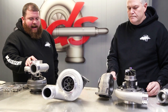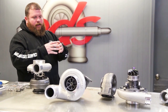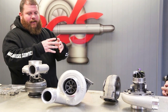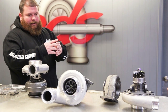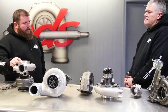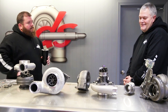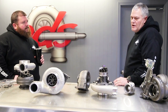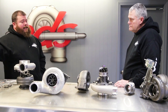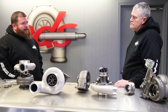What is there to be said about cycle fatigue failures? Every time this wheel changes RPMs, that wheel shrinks and grows. You spin it faster and that wheel expands — albeit a minute amount — and as it slows down, that wheel contracts. Does the billet have more ability to withstand cycle fatigue failures than a cast wheel? It does, but it's only a minor difference. People like the shininess and the thought of having a billet compressor wheel. The high cycle fatigue resistance is slightly better, but not hugely better. I think somebody went to a titanium compressor wheel — wasn't that a cycle fatigue fix? I believe that's correct — that was Mack trash trucks or something.